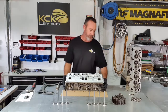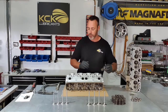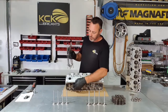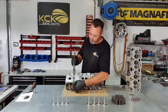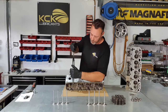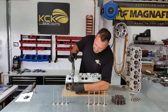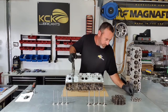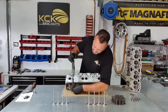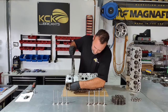That's it, first ones together. So same deal, I've got them in order. Let's keep putting them together, make sure the collets sit in there nicely. You'll find if they don't sit in, normally they'll shoot out across the bench. It's not really something you can half do. And just visual check, make sure everything's clean, there's no grime on there or dirt that we missed originally.